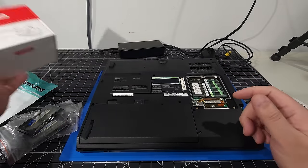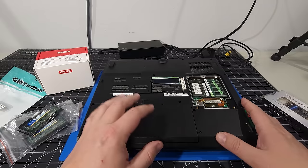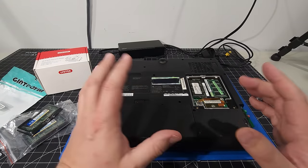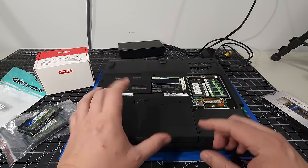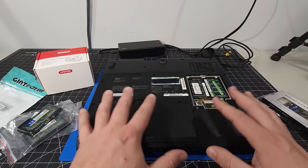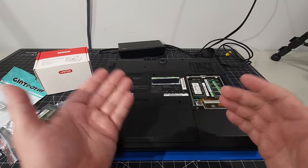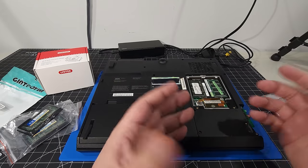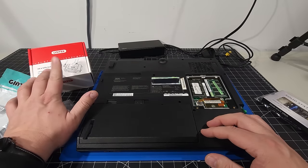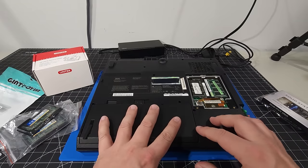So that's essentially the process that you do to do a complete image from one disk to another to avoid having to do that. Actually, I do that quite often on some of these machines that I find. Remember the Compaq ProLinea, the 575 that I have? That's one of those Compaqs that have the BIOS installed in the hard disk, similar to the Compaq Armada 1700 we did a video on. So once I do these restorations, or once I have another computer that I've found that I need to do a backup or an image of, I do that directly using this adapter. Worth its weight in gold. I tell you, all these little neat adapters allow you to really work on this retro tech.